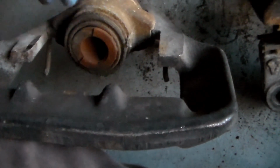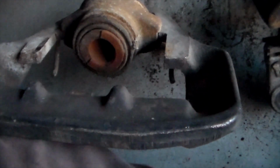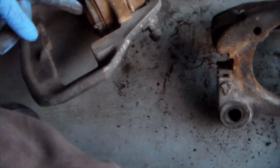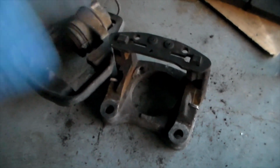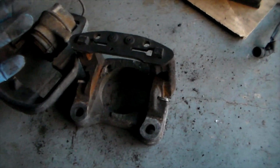And the inside of the cylinder bore was just totally ruined on those, and this is worse than all the other ones. But now that we're at this point, I can go ahead and get this sent out and take apart that cylinder, and I can start wire brushing everything. What I like to do on these is I typically get a chemical cleaning solution. Sometimes you can use oven cleaner, which is pretty cheap, very affordable. It's about the same price as brake clean, but it works better, surprisingly.